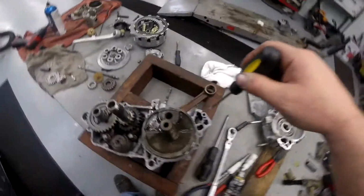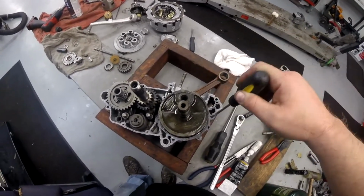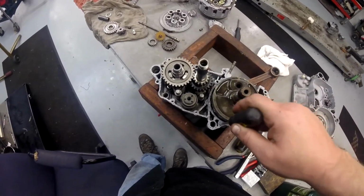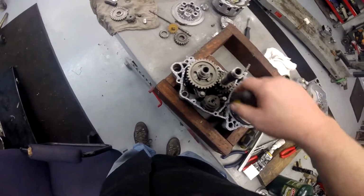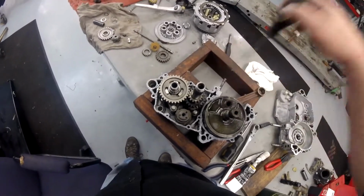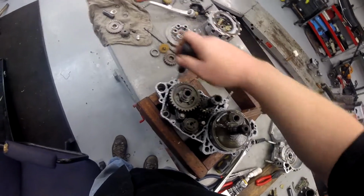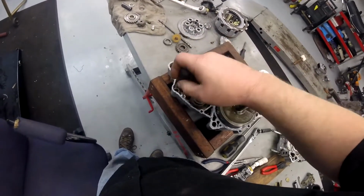Now you see these holes where I filled up the orifices? I go back and do what I'm doing here. See what I'm doing there? It's not really a big deal, but it just keeps excess sealant from filling up your threads. If you get a whole lot of Yamabond behind a thread, you can actually bust an aluminum case, because when you crank the screw in to that female, if that screw is long enough and you pack that orifice full of a non-compressible liquid like oil or water or Yamabond, you'll blow the aluminum out of the other side of the case, torquing the bolt down. So it's pretty rare. It's not a big deal.